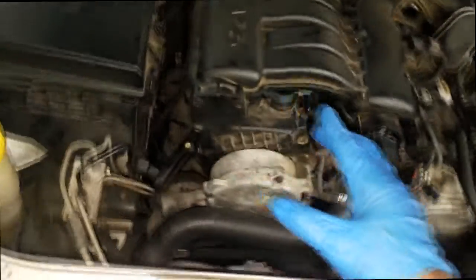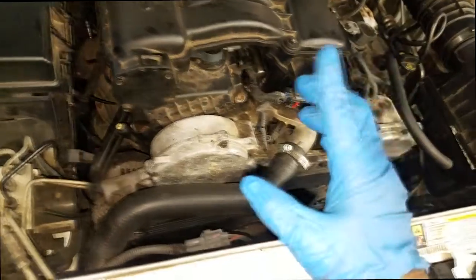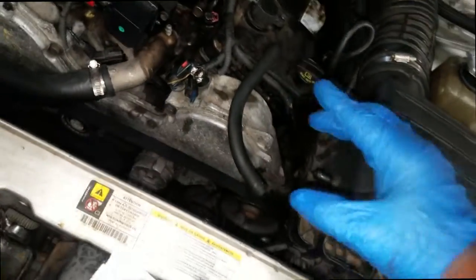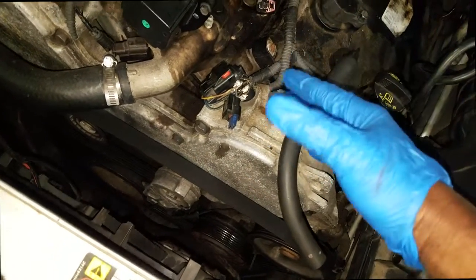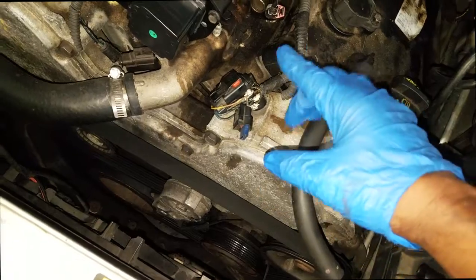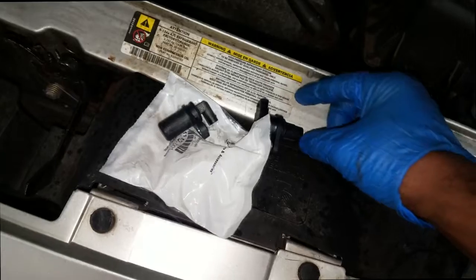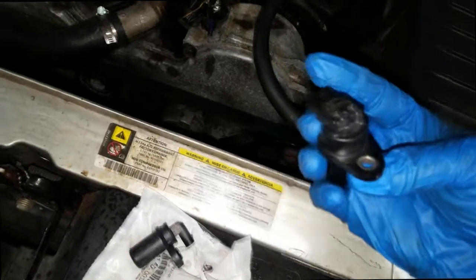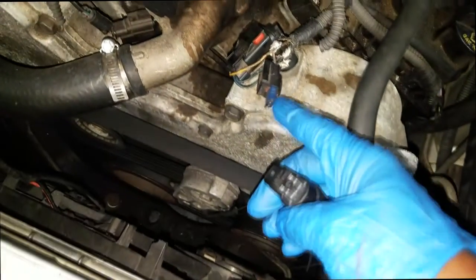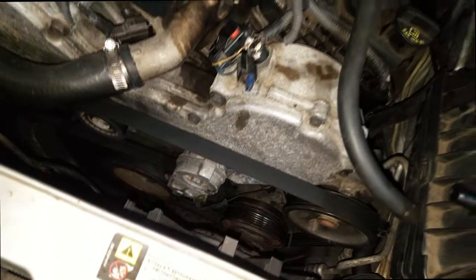What I want you to look at — I don't think this is a good idea and I don't think it should be done this way. This is the wrong cam sensor. If you go to the Chrysler parts department and try to get a cam sensor, you would get one that looks like this — hence the reason they left the original connector on them.